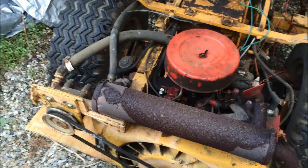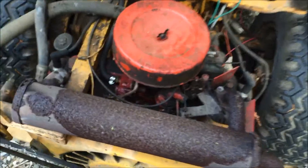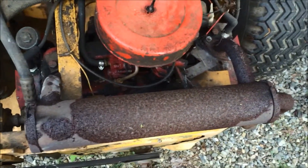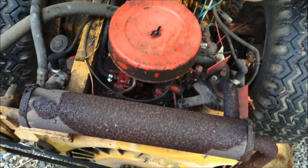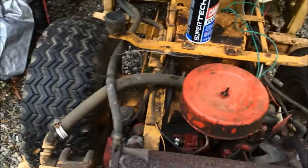So I really don't like to run this thing — that's the first time I've ran it since I knew this problem happened last fall. I think what I'm going to do is just take the starter off this one and throw it on the other engine, just because we're running out of time on this project. To take this motor off it's a real pain because of the hydraulic pump over here, so I actually have to take the muffler off. The muffler goes around the bracket for the hydraulic pump, so you can't actually take the motor off unless you pull the muffler off.